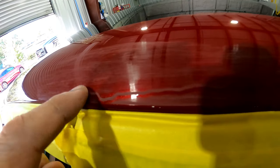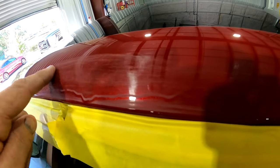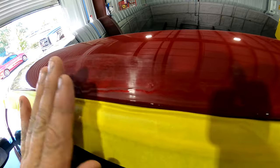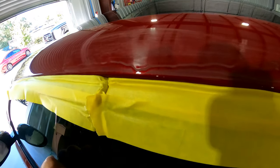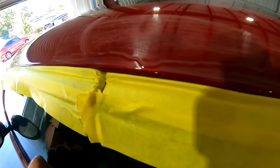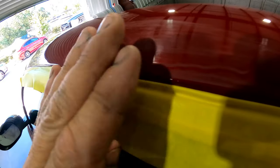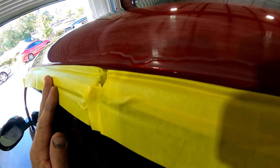You want to make sure that you stay on the run. You don't want to get up here and be sanding the area around it because you'll end up burning it. You want to plane this off and use the coarsest grit. It's kind of like when you do bondo — you start out with a coarse grit because you want to get it flat, and then you smooth it out. You want to make sure you block this flat with a coarse grit, that way it levels off that run and you're not leaving a mountain in it.